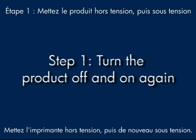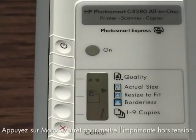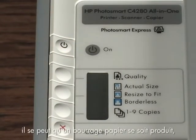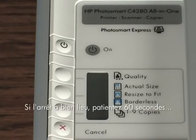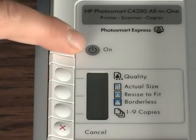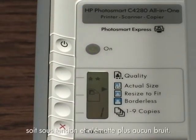Turn the printer off and then on again — this will sometimes fix the issue. Press the power button to turn the printer off. If the printer doesn't turn off, it probably has a paper jam, which we'll talk about shortly. If it turns off, wait 60 seconds, and then turn it back on again. This resets the print mechanism. Wait for the printer to turn on and stop making noise.